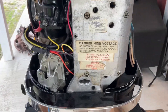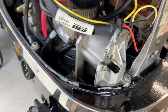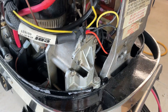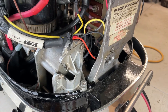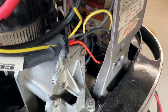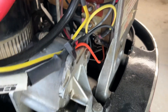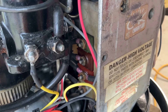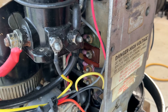Coming over to the other side, the second component is your coil. Super simple, two-wire connection, and then obviously the spark output goes right to your distributor — that's just to distribute spark. If you want to test this out, you can hook your spark tester right to that. Basically, it's got a ground that goes right to the case on your box, down there on the bottom. It also has a black wire — mine is green, but it could be black — that goes up top. That's the black wire that comes out of your coil.